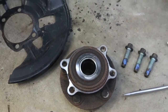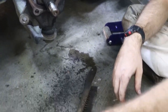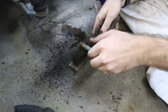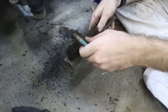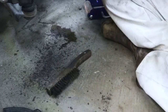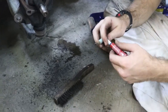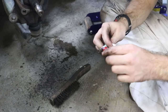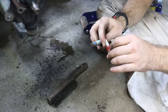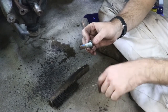All surfaces are cleaned up and ready to go. Before putting the bolts back in and reusing them, grab a wire brush and clean some of the rust off, hit them with some air, and then run a little blue Loctite. I'm using blue because these don't need red. The caliper bracket bolts have red Loctite from the factory, so I'll use red on those.